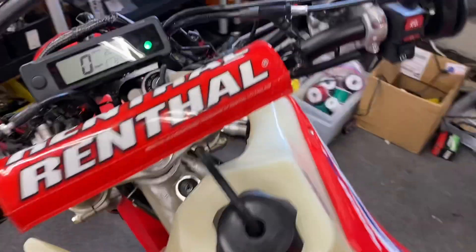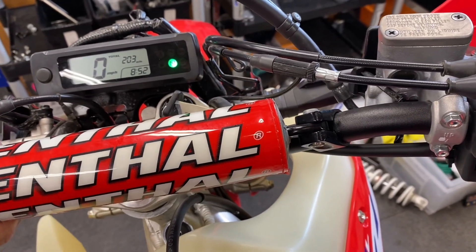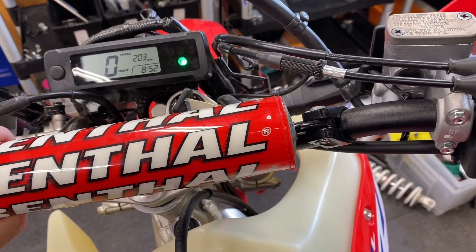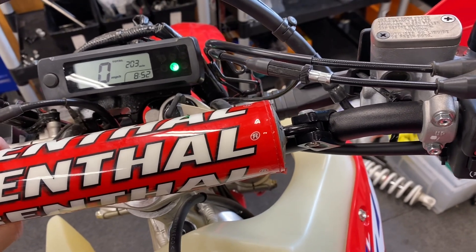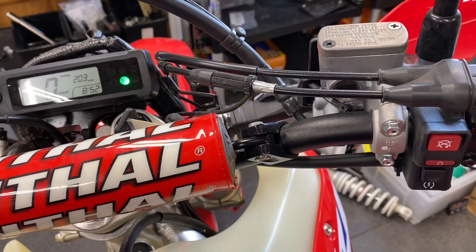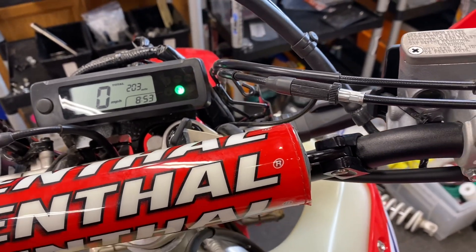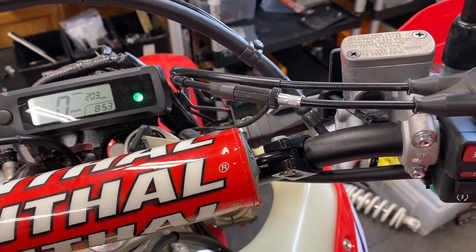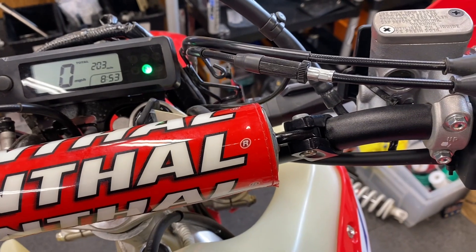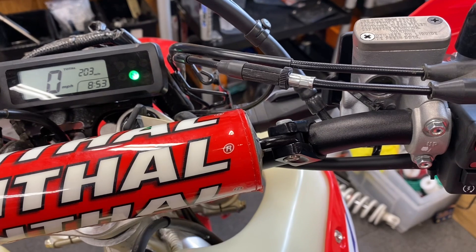Next up, we'll show you how to activate the active traction control mode on the 19-plus Honda CRF450L ECUs. Vortex has added a function in its active traction control — it's looking at the throttle position relative to engine RPM, and then it's making calculations to tame out and control wheel spin. It's very similar to what Athena is using on the Get ECUs. I would estimate that the Vortex system feels about like a level five or six out of the ten variable positions of traction control on the Get. With the Vortex, it's just on and off; with the Get, it's a rotary knob that you can select through ten different modes.